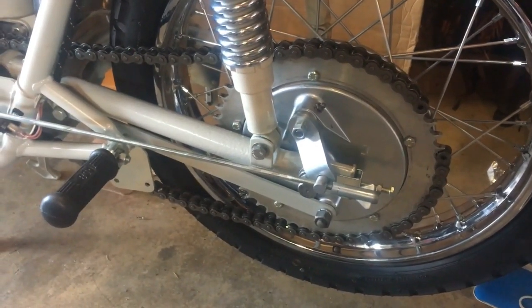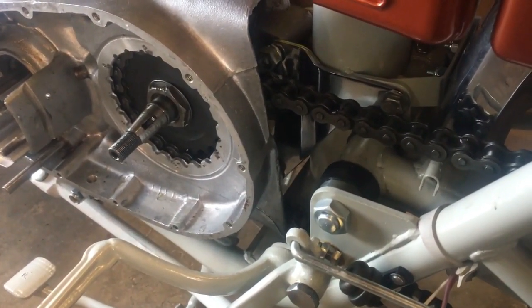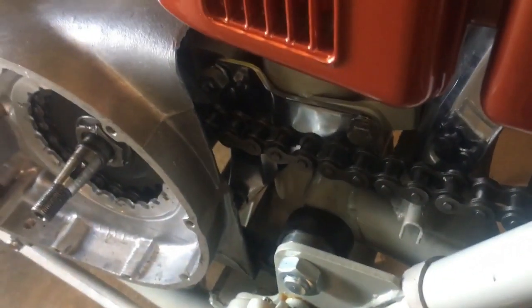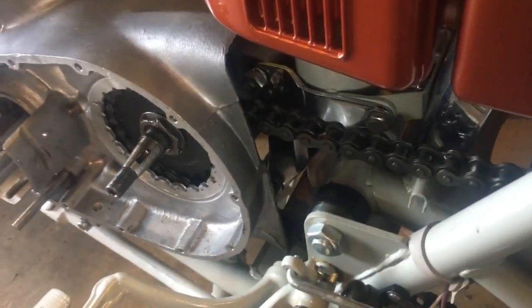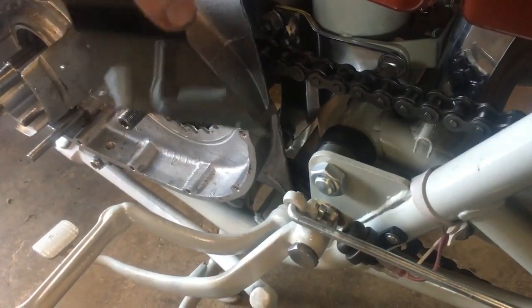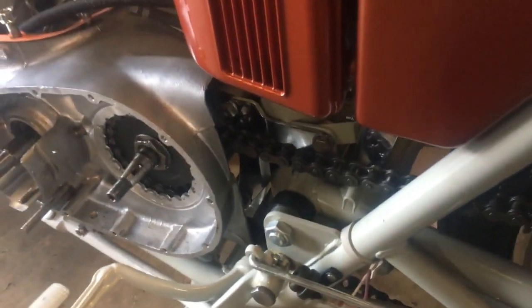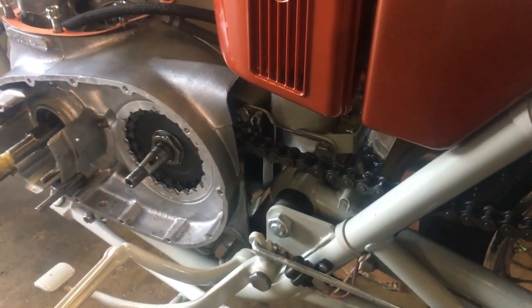What I'll do now is go back up the top end and fit the sprocket back plate, which goes behind the sprocket and chain and is held on by three screws — so that's easy enough. That's the part in question that goes on the other side of the sprocket and the chain. We'll try and get that fitted now.